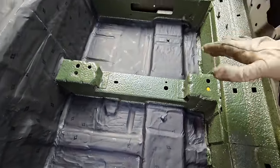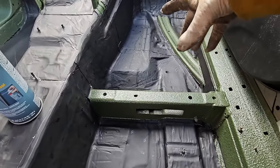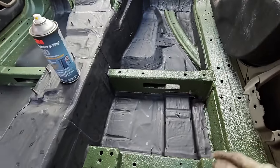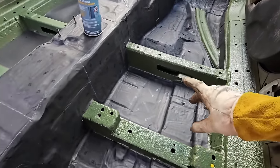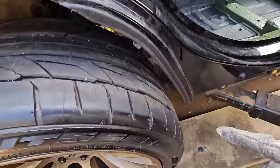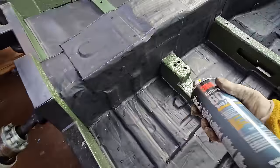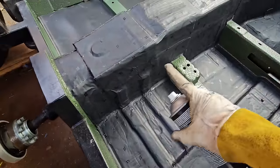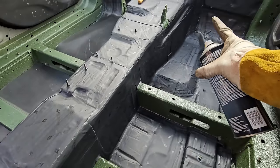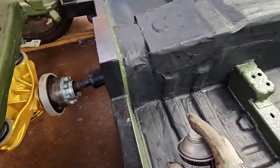Huge change in tone. That shouldn't resonate as much, should block out a lot of the exhaust noise. But I want to go ahead and put some sound insulating foam rubber down also — that should block a lot of the road noise and exhaust noise, try to keep noise out because I know it's going to be crazy loud with the very minimal exhaust. Going to go ahead and spray down some 3M rubber and vinyl adhesive spray, get good coverage on here. The foam doesn't really need it on the bottom, but definitely up on the sides. Foam is going to come from the bottom up onto the side of the trans tunnel as much as I can based on the material size that I got.